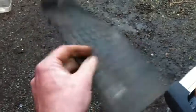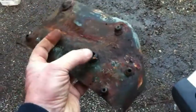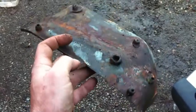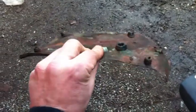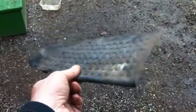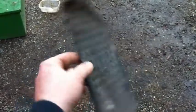Obviously it's not a very good design really - it's not rubber, it's just a piece of plastic. Where the prongs go, water can just get sprayed up by the wheel, up around the edge and underneath, and it just fills up with water and then corrodes away. So when I put this in I'll probably seal around each prong with some silicone or some instant gasket - something like engine builder's gasket - to basically seal it up. But that should scrub up nicely. A bit of poor design really - you're better off with a bit of rubber mat.